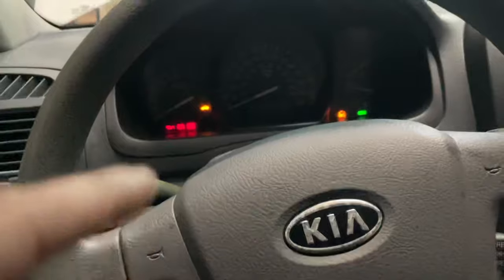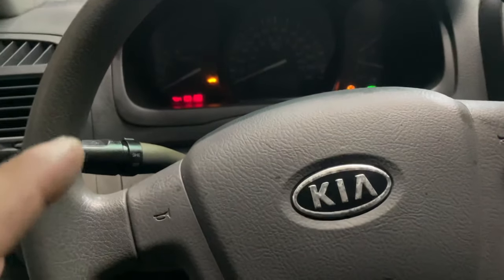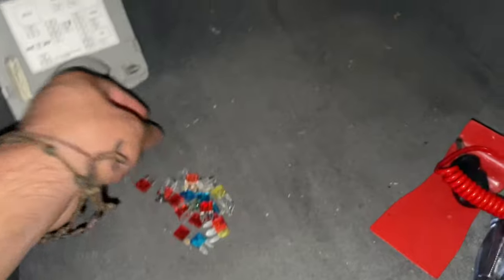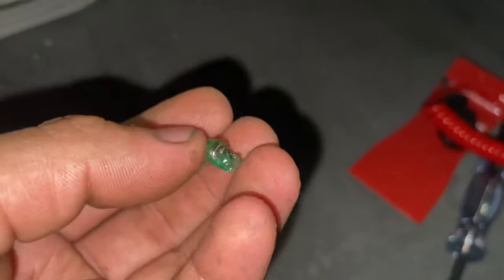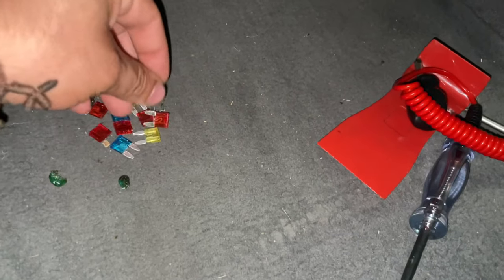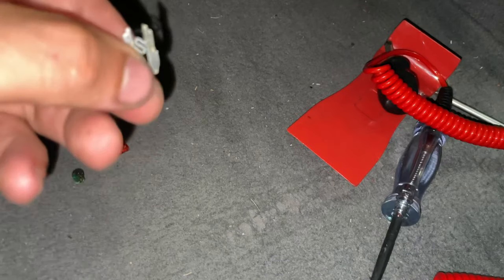The customer brought something up that's kind of concerning. Let's go down here where the fuses are at and I'll show you what we found. These are our fuses right here. Let me show you one of them — this is the housing of the fuse and it is all melted. I don't think I've ever seen something like this, because when I would pull some of the fuses out, this is how they came out.